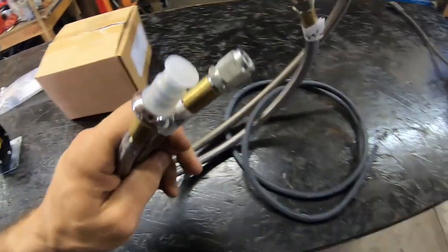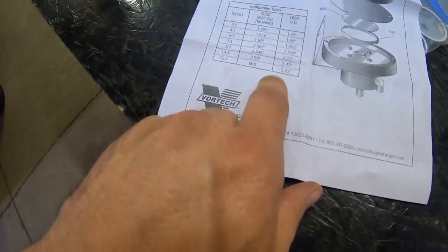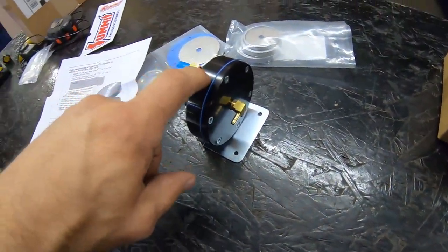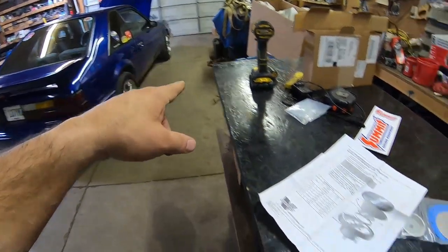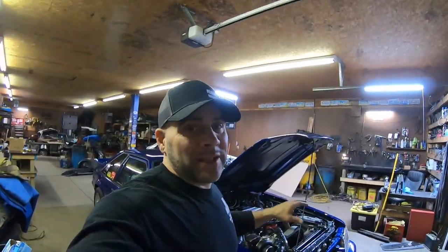The new Vortec FMU stuff comes with brand new braided dash-four line and hookups just like my Kenny Bell does. All those little discs and spacers change the flow rate on the internal part of the FMU — it's adjustable. We're going to set it to 12 to one, which flows the most fuel on return, and see if the new FMU keeps up better than the last one. I want to find out if putting the 12-to-1 disc with 19 pound injectors in a brand new FMU will actually change the fuel ratio. Unfortunately I can't test it in this video because I can't get Ohio to stop snowing, so we have a second trick to talk about.